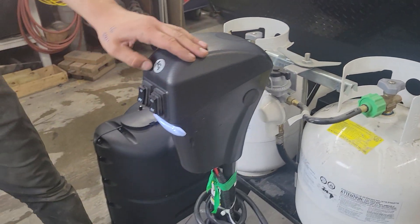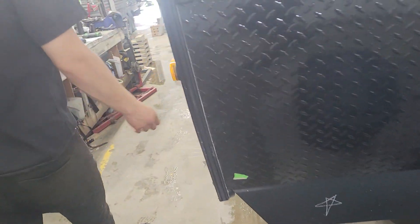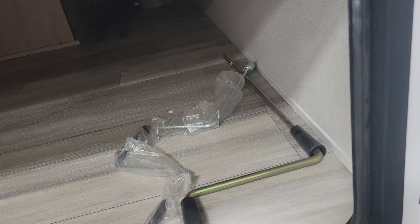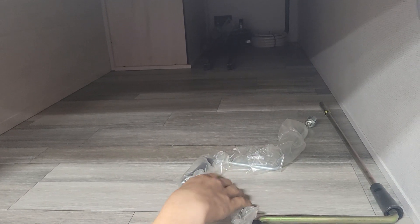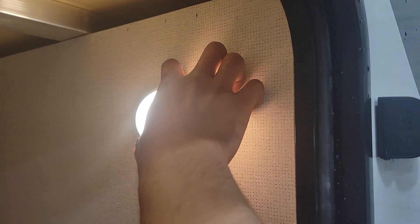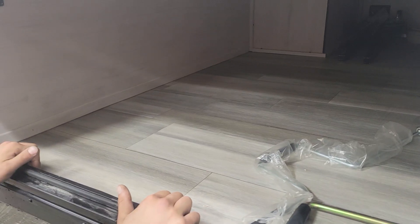In front is the power tongue jack. On the left you get your light switch, on the right — down is up and up is down. The other end of your storage compartment here has two little manual overrides: the silver one is for all your power stabilizers — attach the rod on the other side and run them up and down. The big one is for your power tongue jack up front. Inside there's also a little light up on the front wall. It's a dual-function switch: over to the left is just on, over to the right uses the motion sensing. Once it senses a lack of motion for a minute or so, it'll turn itself off, and turn back on once it senses motion again.